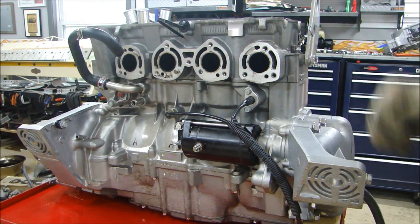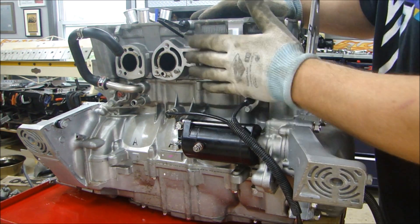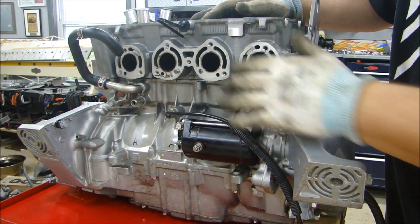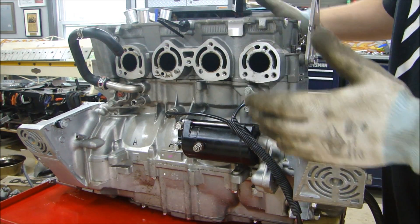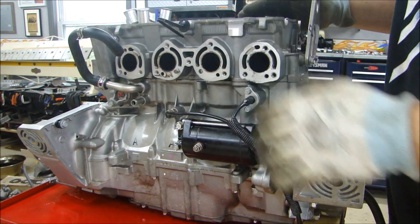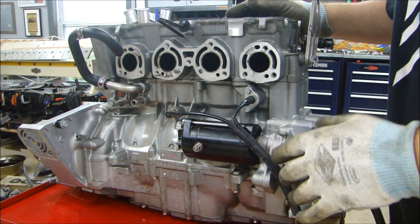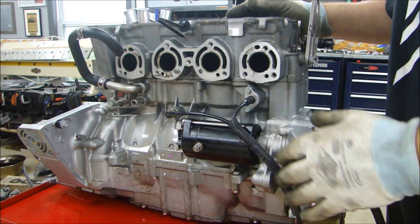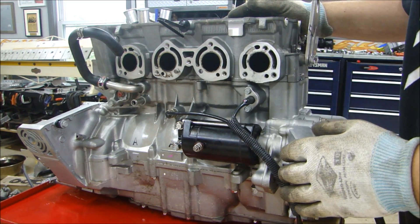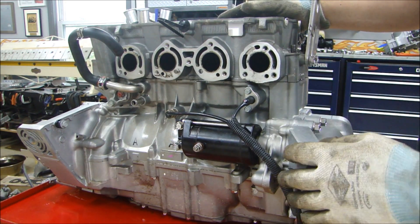So this is where I am. I decided to take the engine out. Once I took the exhaust manifold off, it was clear it was very easy to take out — there's only four bolts holding the engine in. There was nothing really connecting the engine to the jet drive except for a fast coupling, which doesn't have any fasteners at all. I put it on a hoist and took it out in about fifteen minutes. Much easier to work on when it's on a tabletop.